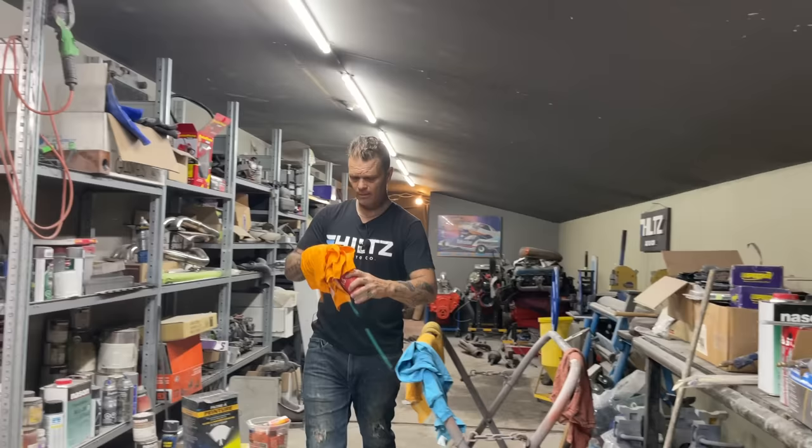Get my glasses. I'm right back. What's that? It says 2-1. Good thing I went and got my glasses and checked. 2-1. I could have messed up just like that. So we'll go on the 1-1 scale. It says 1-1. So if I go 1 there for the epoxy, 1-1, so I go 1 for the epoxy hardener. Where it's 2-1, I go 2 parts epoxy.